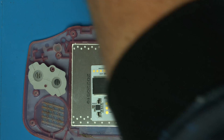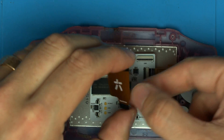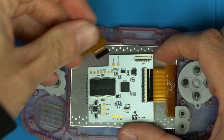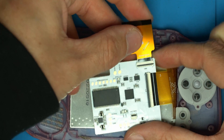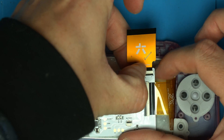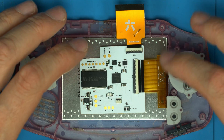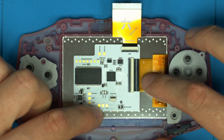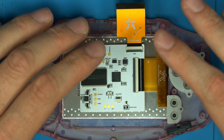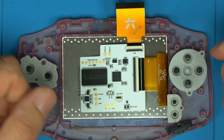Because this board is a 40 pin, I've grabbed a 40 pin ribbon. You want to do the same here — lift up the latch, insert the 40 pin ribbon where it says 'clean screen', black side up, and latch down. I will show this install in one of our shells with the on-screen menu and the button ribbon soldered, but this is purely the drop-in no-solder install, so there's no need to do anything else — that's the kit installed.